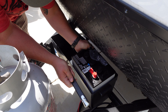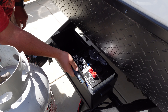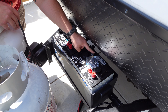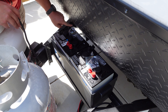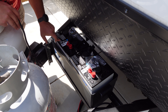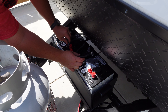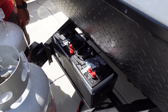If you don't have one of these straps for lifting six-volt batteries, get one — it's the only way to move those around. We're going to be mounting these in series, which means connecting the positive to the negative on one side, then my positive cable here and my negative cable over here going to the trailer. These two are actually going to be connected so all the cells run together, giving us 12 volts instead of just six volts. You can orient them however fits your setup best.